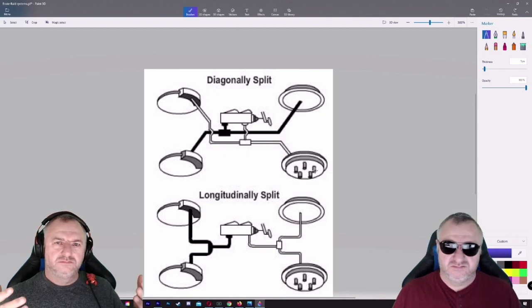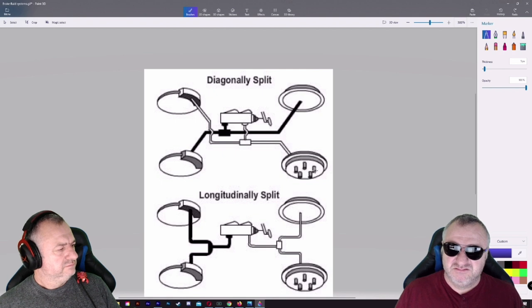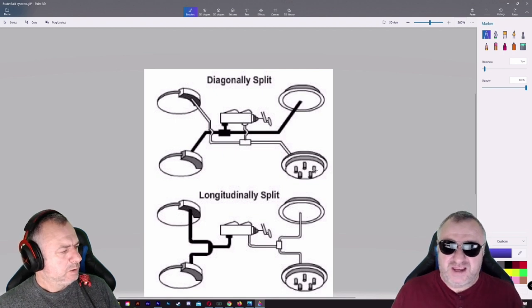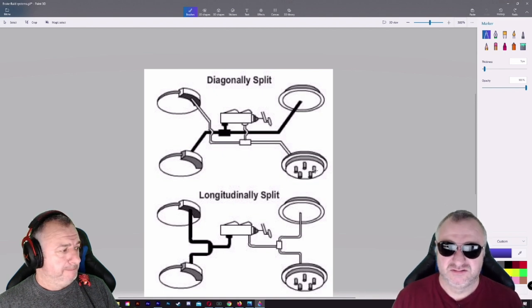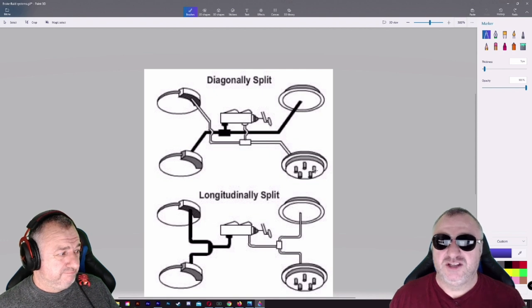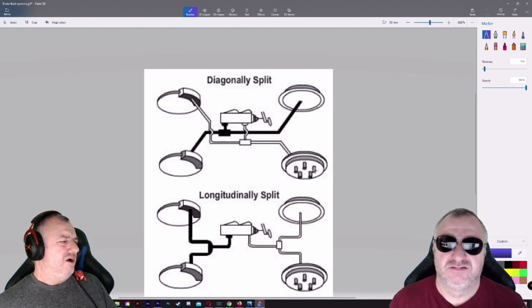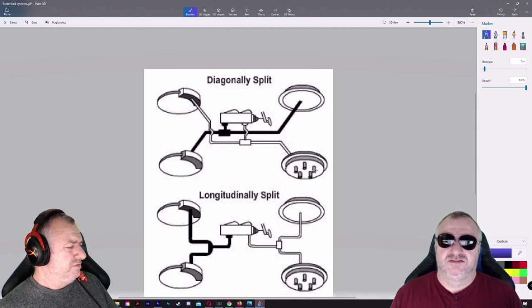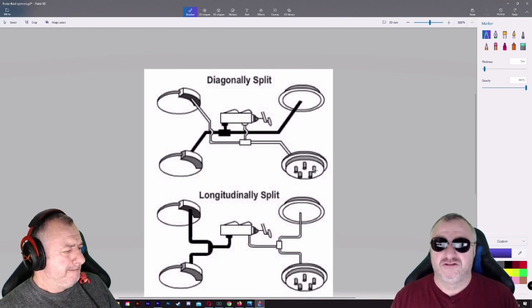Let me ask you something. If you're going to push those brake calipers back, what do you do? You just push them back? No? Why no? Because you need to open up the brake fluid bottle cap. Yeah, the brake fluid bottle cap, to get the fluid out.